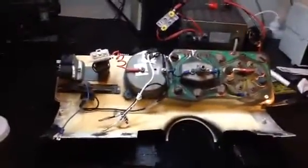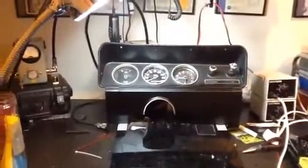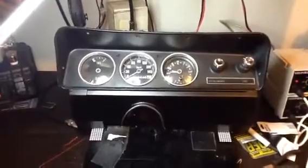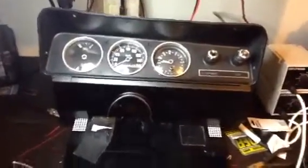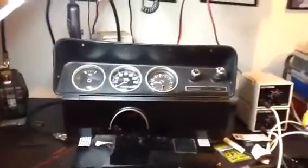That dash is not far off now from getting put back. If we have a look at the dash from a bit of a distance, we'll see it's complete. The sag in the middle is probably half of what it originally was — so by heating that up, I was able to straighten it out.